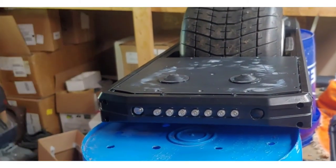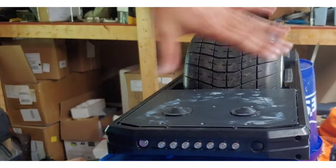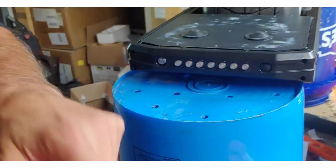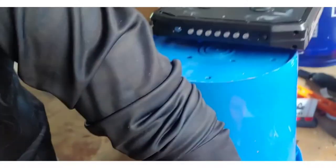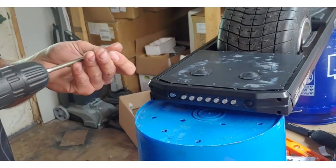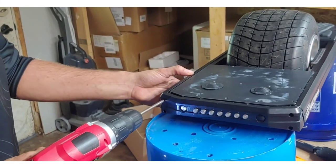Line up the circuit board and we are in. I generally like to put these four screws in first because it will help draw that right up where it goes. You're going to want to start with a very low torque setting — that will help keep you from cross threading or stripping it. If it starts ratcheting, back off and try again. I also sometimes like to go reverse first to help line it up.